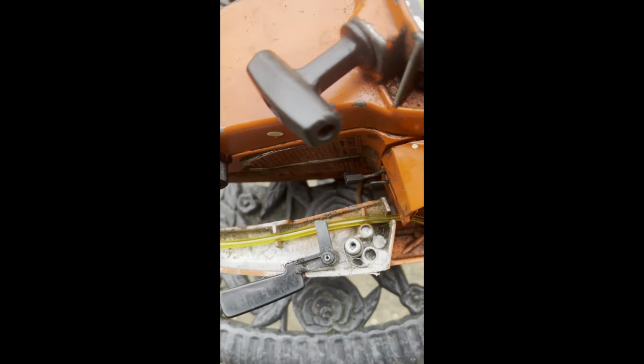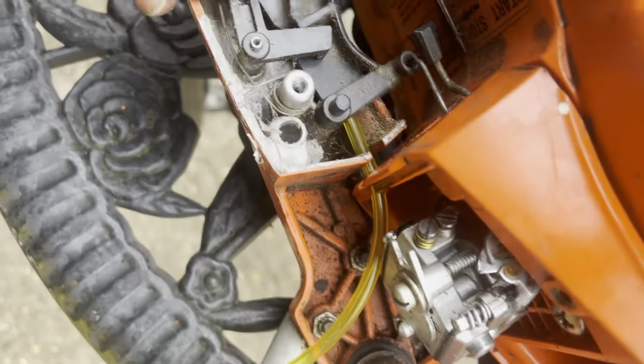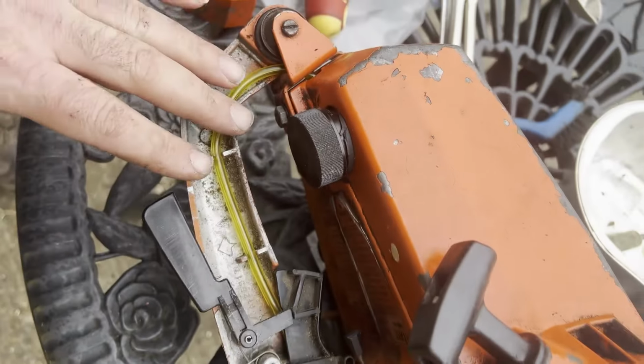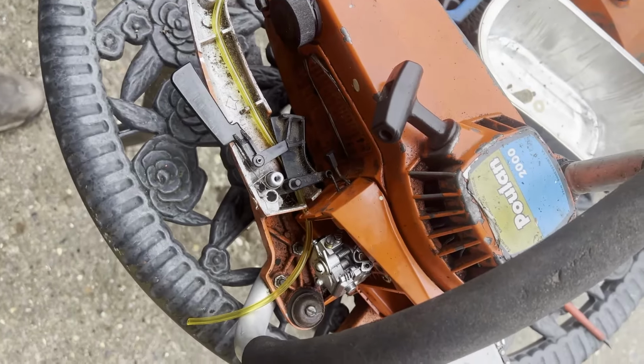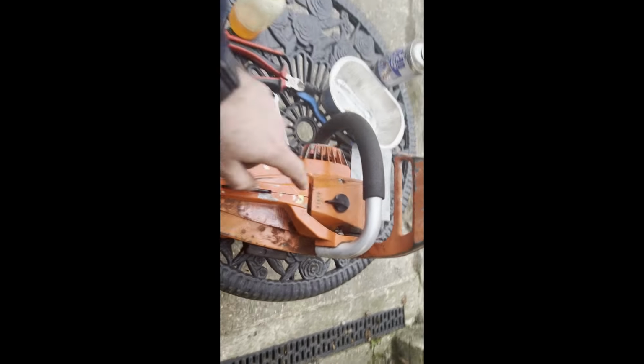Yeah, need two hands for a sec. Yeah, so that's your override. That will pull your throttle, so we can pin this on, and then we'll turn and plumb it into the carburetor. So I put some oily mix in there because I don't know how long the cylinder's not run. Choke's lined up with the slot and the pipes in. I pulled it and pulled it and pulled it. So let's see if we can get a run out of it. Get down the holder and play nice.